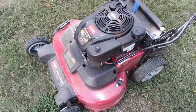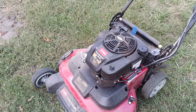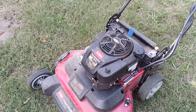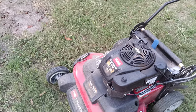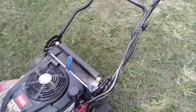I just wanted to mention this because I know a lot of people have problems with the mower stalling when they engage the blades. If you run the engine at the rated RPM, which is 3600, it's going to run a whole lot better — it'll cut better and mow faster.